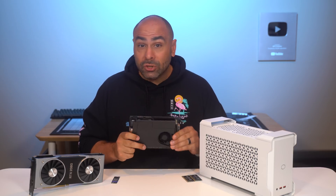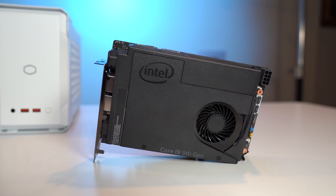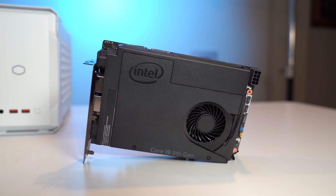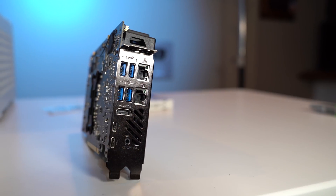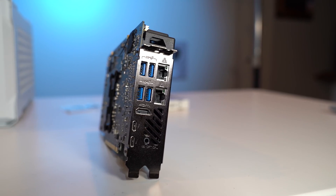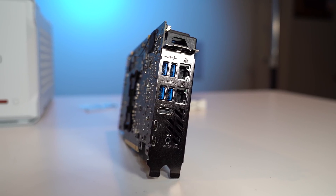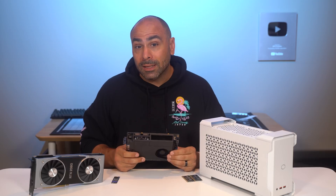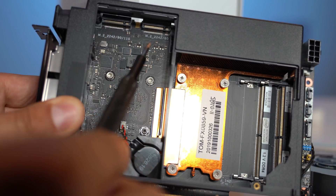This week we are taking a look at Intel's NUC 9 Extreme. These come in a couple different varieties — you can get the i5, the i7, or this i9 version. Inside is a mobile processor, specifically the 9980HK. Although it is a mobile-class processor and doesn't consume quite as much power, it's still 8 cores and 16 threads with a rated boost clock of 5 gigahertz. It's no joke. It definitely can't compare to something like a 10th-gen 10900K and uses the previous generation 14-nanometer process, but it is still a very capable processor.